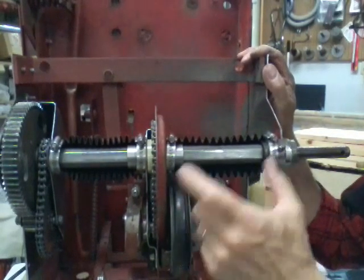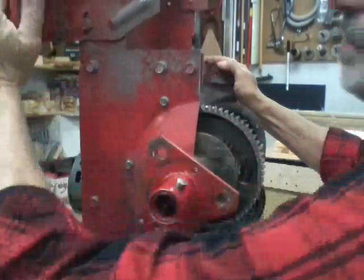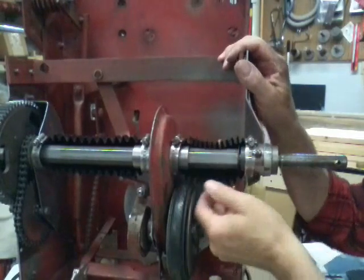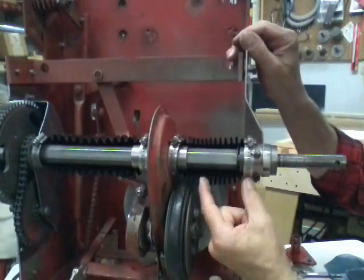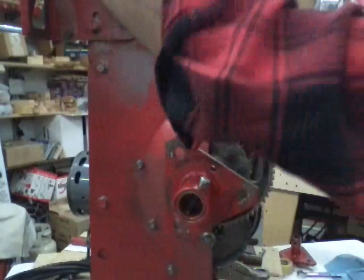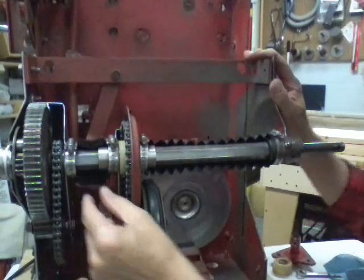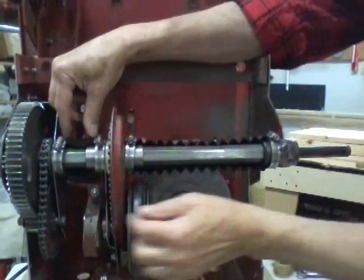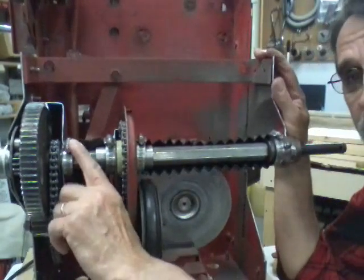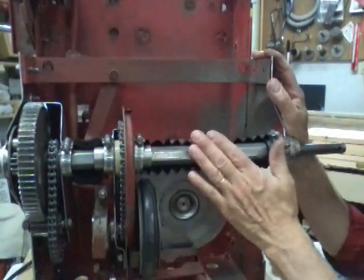I'm going to shift this into reverse. See how loose this is, how much room you still have for that extra end. Now I'll put it in fifth gear. You can see how compact this is — it's bunched up as tight as it can get and still allows it to get into fifth gear. So if you put that boot on this side with the extended end, you're not going to be able to shift into fifth. Make sure you put it on this side.